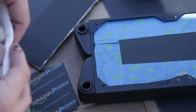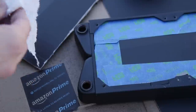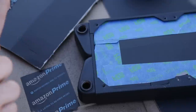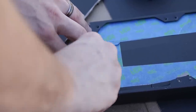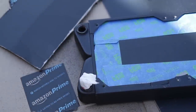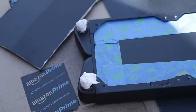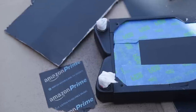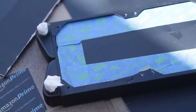The last thing you want to do to prepare your radiator is to protect your fitting ports so that you don't get paint down in them. Paint inside your radiator is a bad thing. Take a piece of paper towel — something non-fibrous, not toilet paper — roll it up and fit it snugly down inside the tube and fitting port. If you have fittings or plugs, you can thread anything G-quarter threaded in to protect the holes.